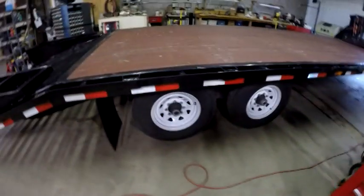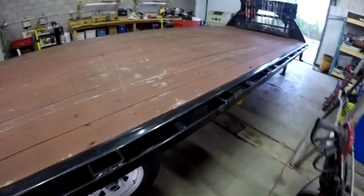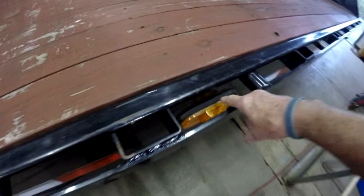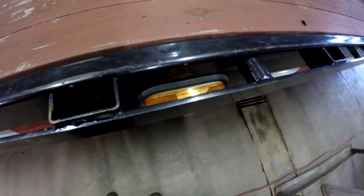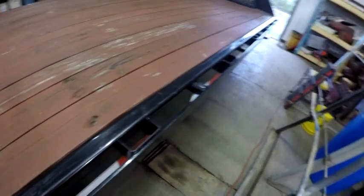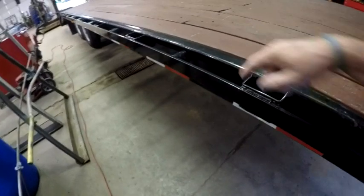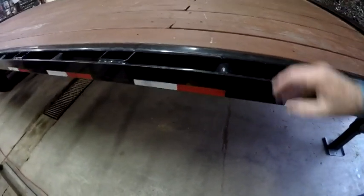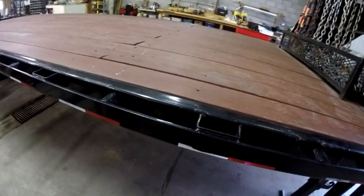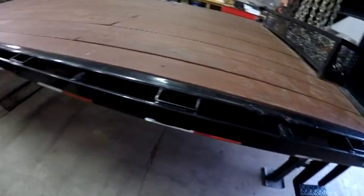What this is is tube steel, and the new lights for trailers mainly have just a rubber grommet around the opening and the light just kind of sits into the rubber grommet, held in like that. So all I'd have to do — if I can get that style light — is drill a hole probably with a hole saw into the tube steel for the size of that rubber grommet, and then just capture the wires that are inside of that tube steel. And there are wires inside the tube steel — let me take you over to the other side and I'll show you.